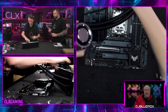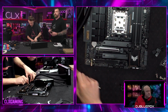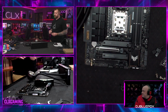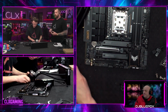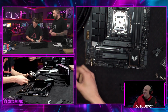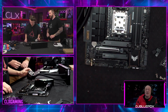Yeah, and if you don't put enough, then you'll notice it in your performance. You'll see that it's probably overheating. You might start stuttering in games and stuff like that because your GPU or CPU is trying to slow itself down. So you'll definitely notice it more if you don't put enough on there. That's not authorization to just go nuts and ooze it all over your CPU, though. Yep. Please don't use the entire tube.